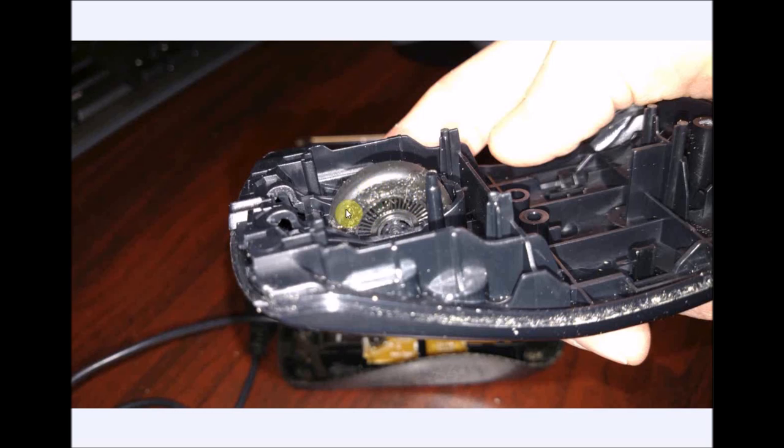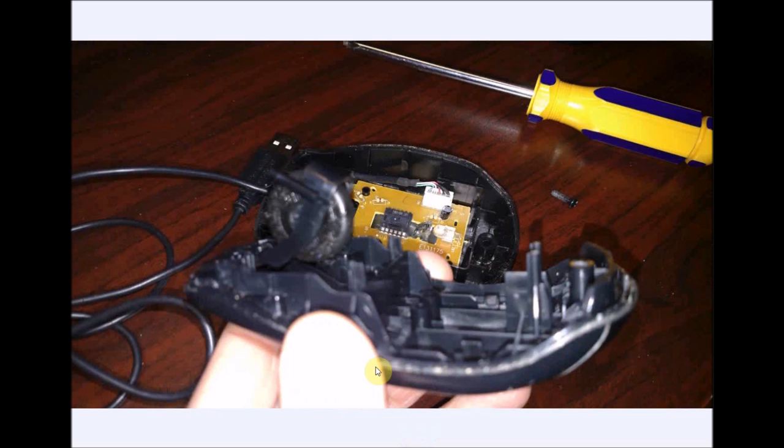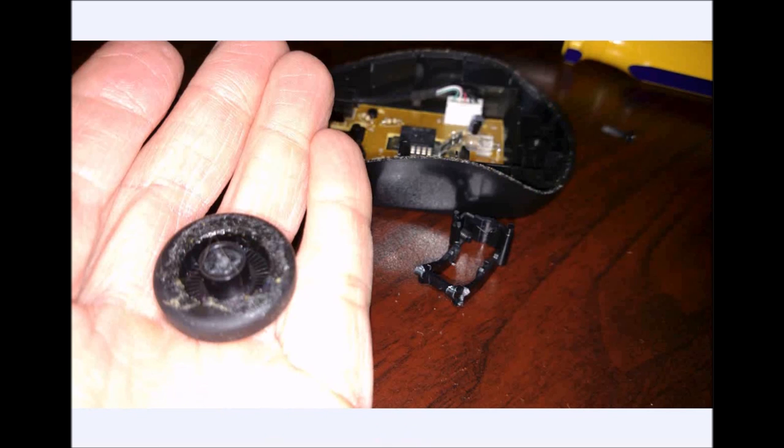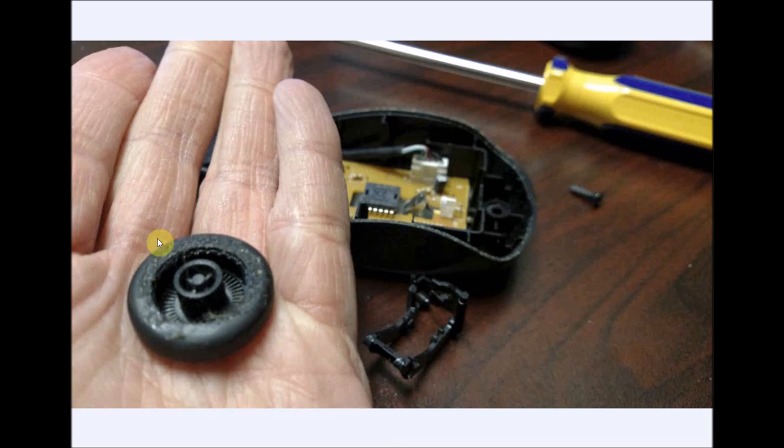You can see there's a rubber membrane on this wheel — we're going to take that off and use a rotary tool to expand it a little bit to the right size. Just pop it right out, take off the little housing, and this wheel is all we want. Each mouse might be a little different so the work required may vary. The rubber peels right off — it's held on loosely. Then we're going to cut this out and use a rotary tool to expand the circle until we get to the right dimensions of the BridgeDirect joystick, then glue it inside the housing.